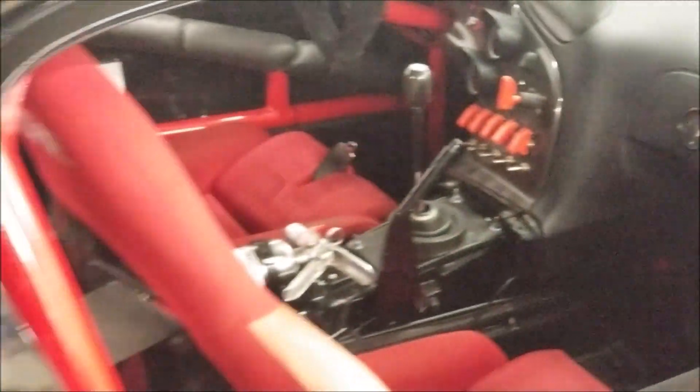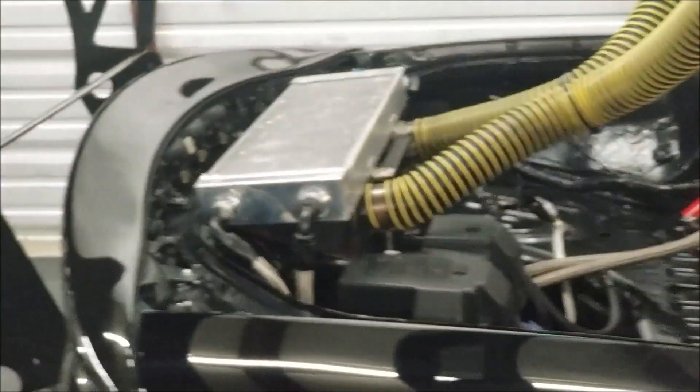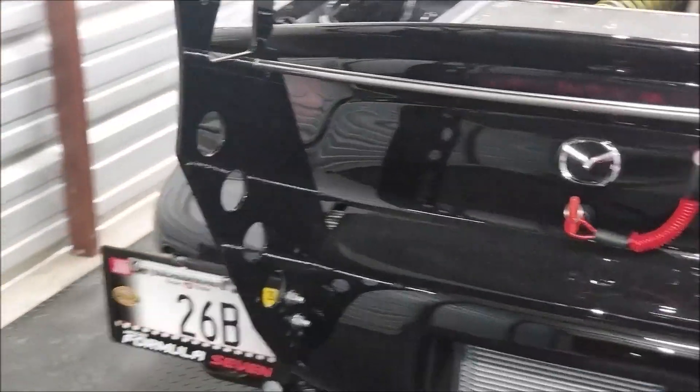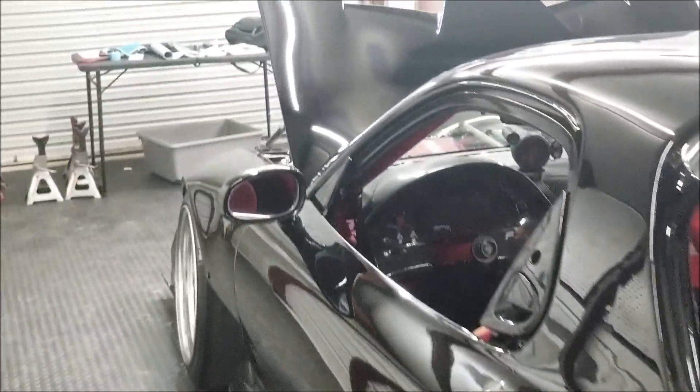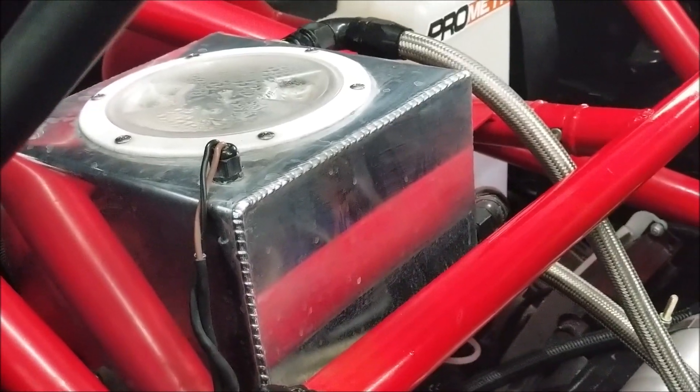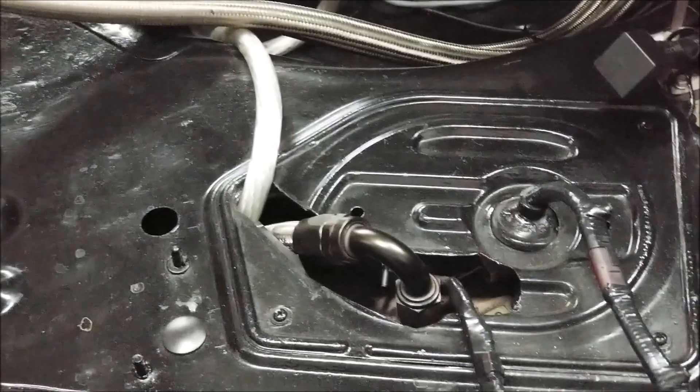Those don't draw a lot of juice, but something you have to take into consideration. And of course we have the blinkers and the lights, the headlights, the driving lights. And then we've got this little tank right here, which is the water-to-intercooler system reservoir, which contains a pump as well — it's a Rule 2000. And then of course we have the Walbro pump that's inside the tank, which powers the fuel. It's the primer pump that we went over in a video before.